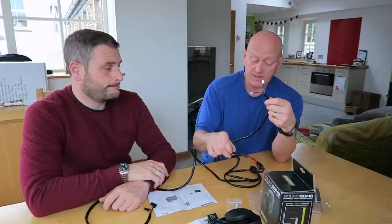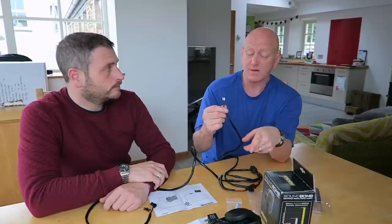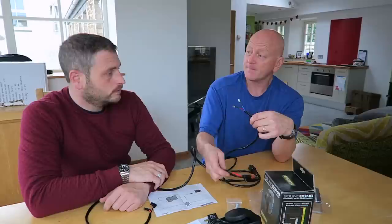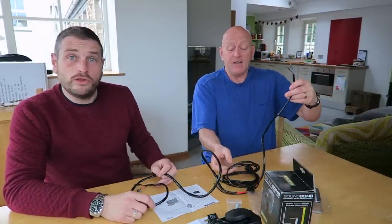The reason you have to connect it to your battery is that the CAN bus system is not powerful enough on its own to power this horn. That's why you've got to connect it to your battery. Every day is a school day.